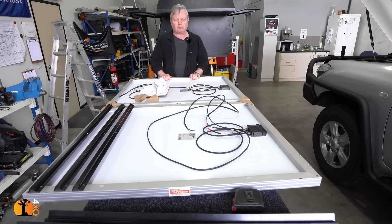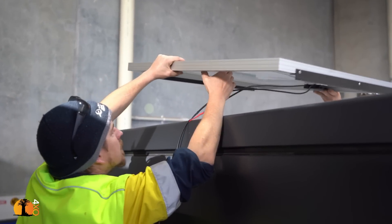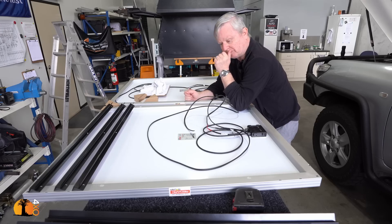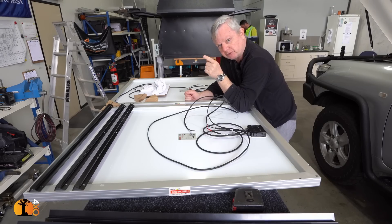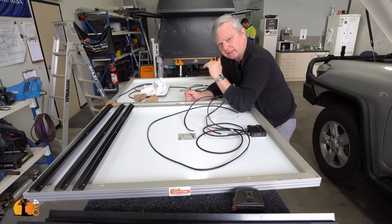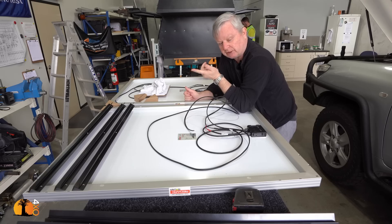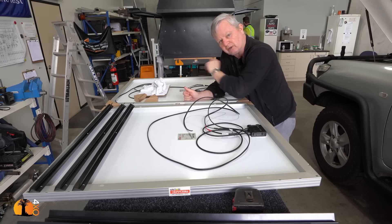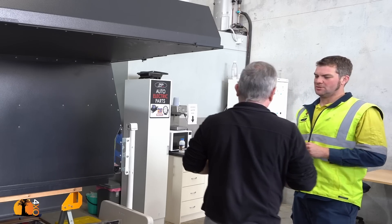These are Red Arc 120-watt panels — we're going to put three of them on the roof, giving a 360-watt input. It's very important when putting solar panels on a flat roof like this that you leave an air gap, because when a solar panel gets hot, the current it produces comes down. On a very hot day, there needs to be airflow. In effect, these will act like a safari roof — a double-layered roof — casting shade on the white camper roof, so they should be very efficient.